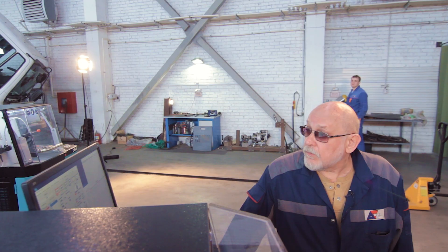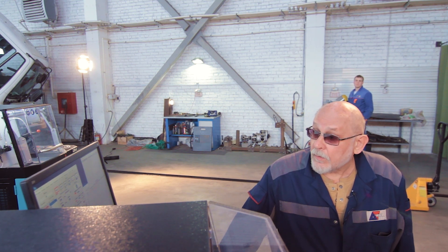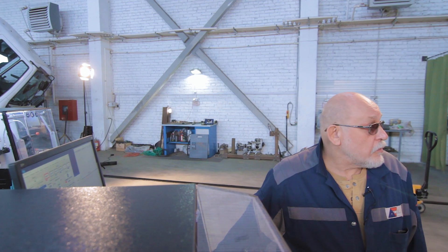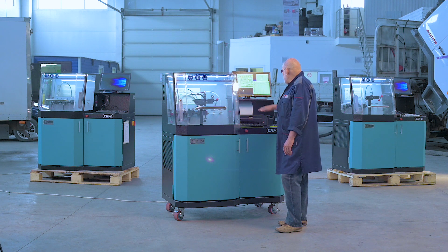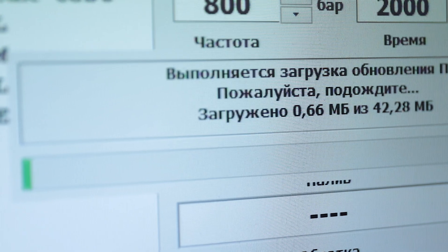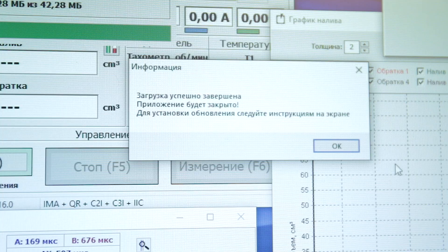The test bench software offers a wide range of settings. In the injector testing process, we can see the dispensing schedule or immediate dispensing. We may generate oscillograms indicating the driving pulse current waveform and system pressure. Testing a piezo injector, we may see the control voltage waveform. These are options for advanced users. The test bench library can keep over 2,700 test plans. The library and software are updated using wireless internet connection, and the system is updated for free.